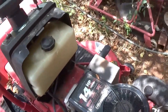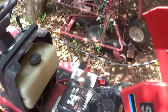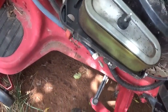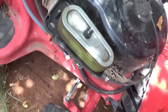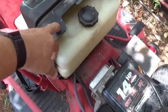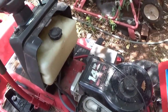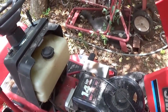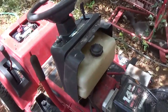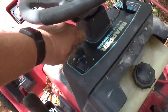A lot of times with these mowers, what I do is get a small gas tank off a push mower, unhook the fuel line where the filter is, mount the gas tank, run a self-tapping screw to hold it in place, put a little gas in there, and see what happens. Let's see if it'll crank over with that battery. Nope, I got nothing.